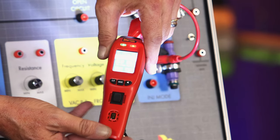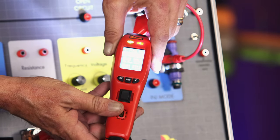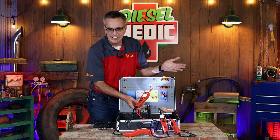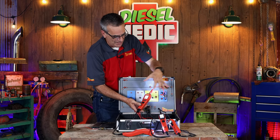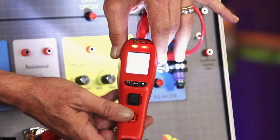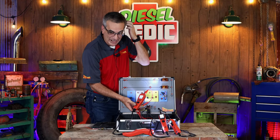It's actually giving you four pieces of information on the screen: the supply voltage to the injector, the ground voltage from the computer driving it, the inductive kick voltage, and the injector on-time. If you're not familiar, any coiled winding will produce a big inductive kick voltage every time it's shut off. That number is different car to car — usually between 60 and 90 volts — but it should be similar cylinder to cylinder, like a compression test. If the windings are starting to go bad, that inductive kick number starts dropping. So four pieces of valuable fuel injector information with one quick back probe. Run down a row of injectors and compare readings — if one has radically different readings, you've got a problem with that one.